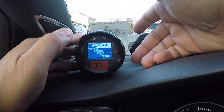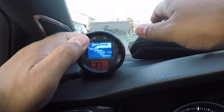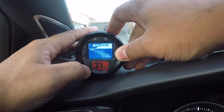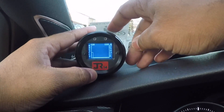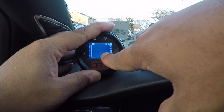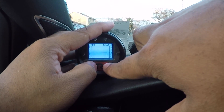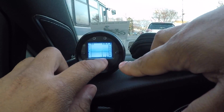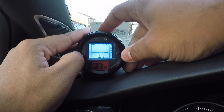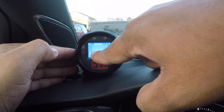You have a bunch of different things you can look at. You can record — you can data log with the car. If you want to actually send data logs out, or look at them yourself if you're more into tuning in depth with your specs, you can data log with this. For instance, your graph — I believe this is showing boost pressure. As you're seeing, it's a linear line because the car is idling. But you can see the spikes and the stuff go up in the graph. You see the behavior as the car is idling. So this is the graph based on PSI of boost pressure — if you want to look at it from a duration of time that you're driving and see where it's peaking or not peaking, you're able to do so. This is a great tool for that.